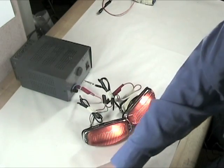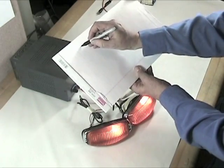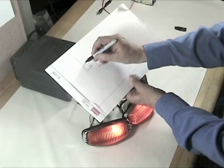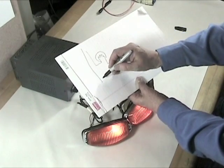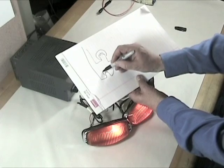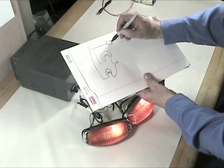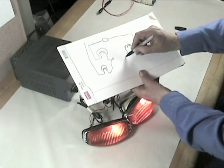I've got a sketch pad here. On the left lamp, a power lead comes down to a large bulb — the brake light or turn signal — and goes to ground. A small lead comes down to a small lamp and shares the same ground. Now, for the brake lights to come on at the same time, there's a union in the wiring harness inside the car. A wire comes over and down to the large lamp on the other side of the car, down to a ground.